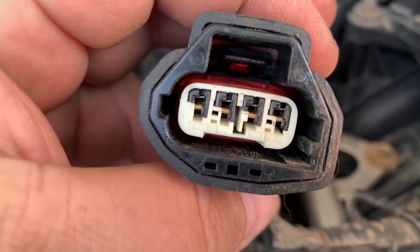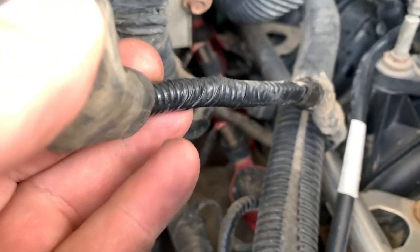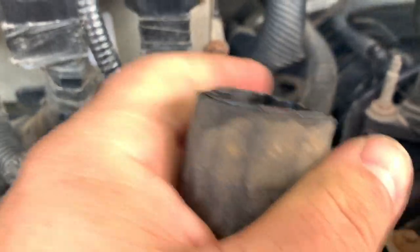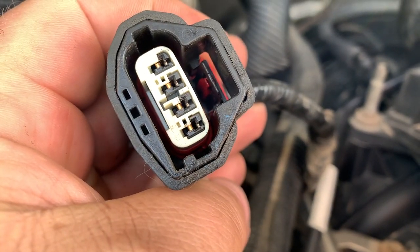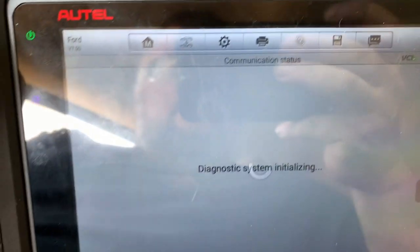At this point you really want to inspect your plug for corrosion and inspect the wires. If everything looks good you can plug it back in. Before getting to the scanner part — if you got any of those codes or multiple codes, you really want to pull up the freeze frame data, because freeze frame data captures the exact moment the fault occurred. If it's not a continuous code, it'll help you pinpoint exactly what the issue is. Now I'll pull up some live data.